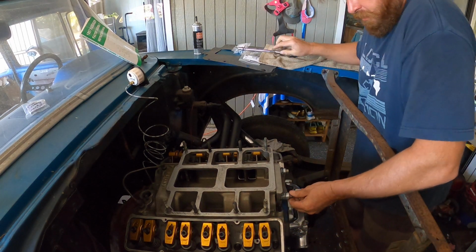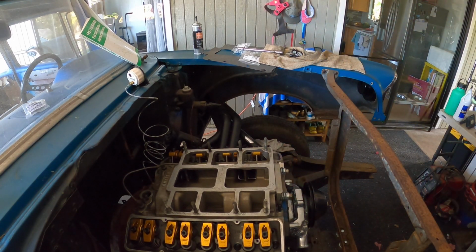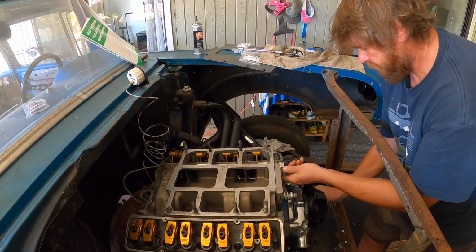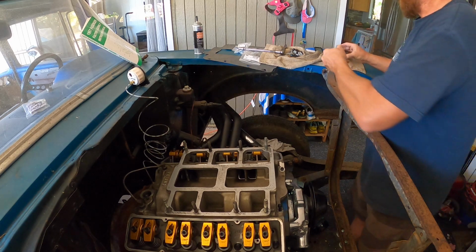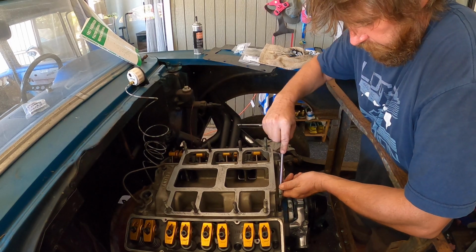That isn't going to work. So I'm going to pull this blower plate off. The pressure plate. Wow, this has just turned into a lot of fun. Let's use the quick gun. This is the blower pop-off plate. If I get too much pressure, it pops off, so it releases out here instead of blowing the blower up, which is, you know, not good ever.